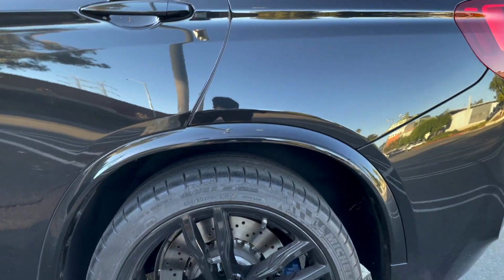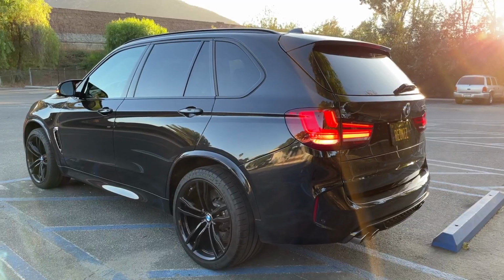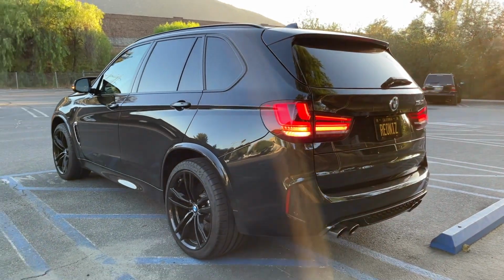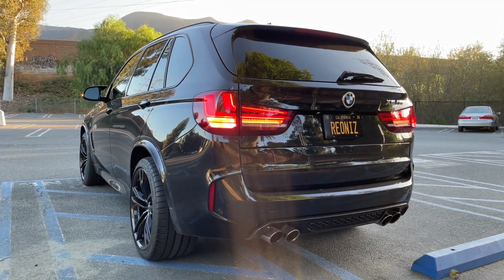Now, something that I mentioned earlier is that I love how wide the tires are. 285s up front, 325s out rear, just really wide wheels on this car. And for the purpose of aesthetics, that is incredible. And again, the rear just looks so chunky with that tire and with the already great proportions of this particular body style. But one of the downsides of having that thick of a tire, especially up front, is it does aid a little bit in a sense of understeer.